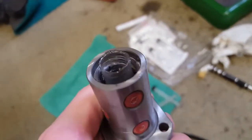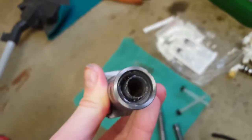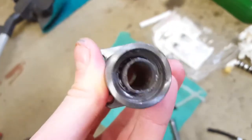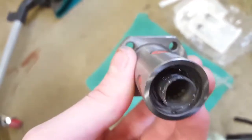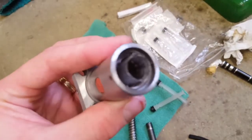So these syringes are actually really useful for filling up or refilling the ball nuts. You can empty all the balls out and then jam a little finger in there with a load of grease in the ball nut, rub it all around in there. Then when you use some tweezers to put the ball bearings in the ball nut, the grease holds them in.